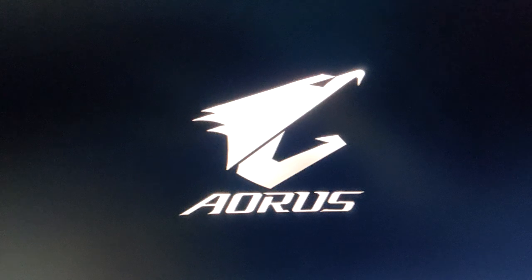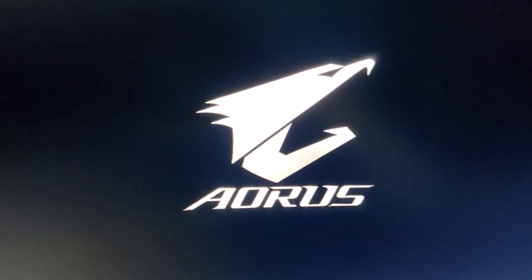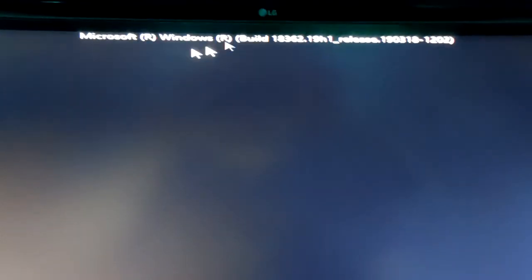Okay, so now once the reboot is done, which I wish this would go faster, you're going to hit the 4 key to enable safe mode, so just hit 4 on your keyboard. And then it should take you to the boot screen. Now you can't use your PIN, you have to use a password, so I'm going to put that in now. So you can see we're in safe mode, and it says safe mode up there.